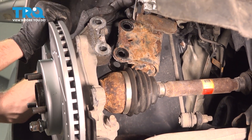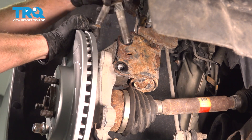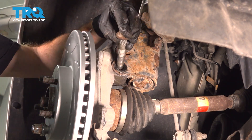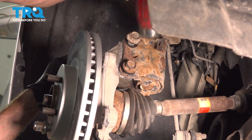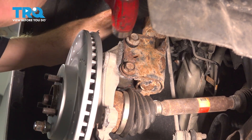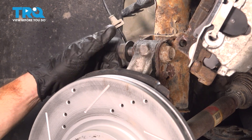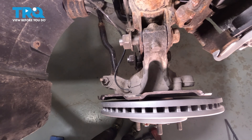Now we can start bringing the knuckle up into position to the front strut. We'll install our two cam bolts — just go ahead and slide them through from the front towards the rear. Put the caliper out of the way and tap these into position. Let's make our way on the rear of this so we can install our two mounting nuts. After applying some blue thread locker, we'll continue on with our two mounting nuts — start them on, snug them up. The torque for each of these is 173 foot-pounds.